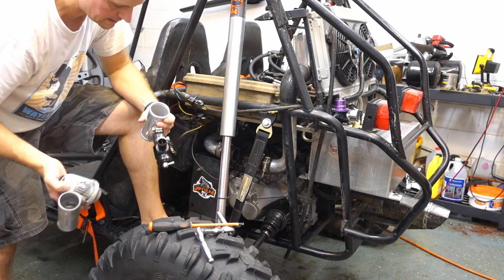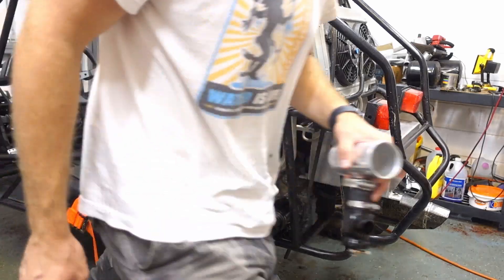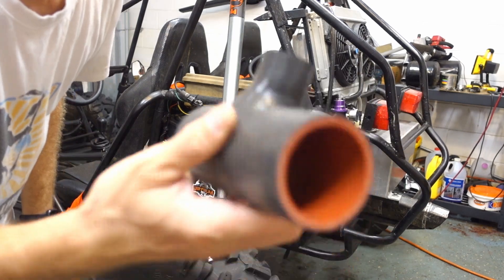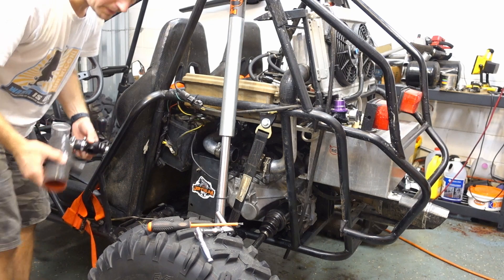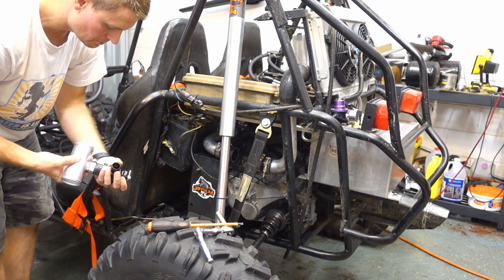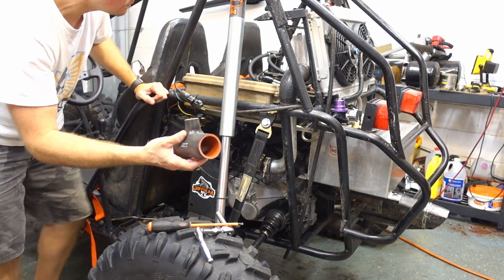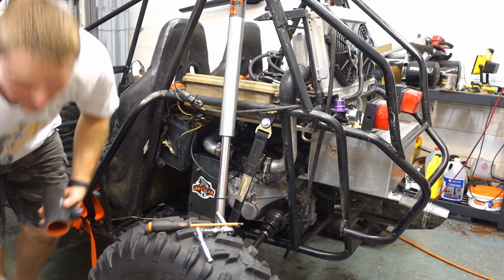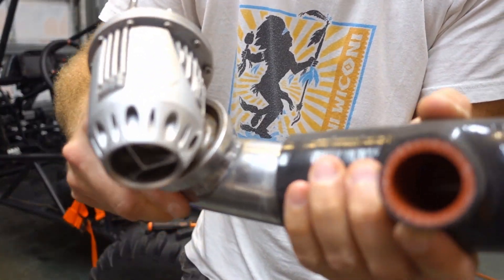That charge pipe is a different size entirely. Let's see what I've got here. You know what I forgot that I had? I had ordered this a long time ago. Yeah, it is all silicone — I want as much of my charge pipe to be solid aluminum as possible, but I don't think a small little section of silicone like that is really going to make a dramatic difference if it fits the blow-off valve piping and we know it's the right size.